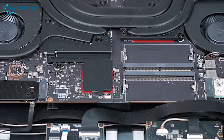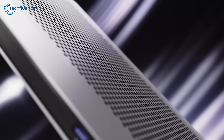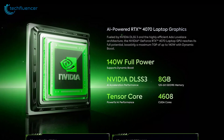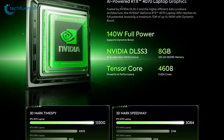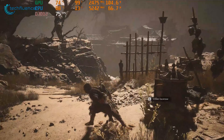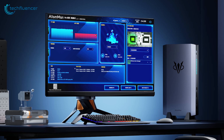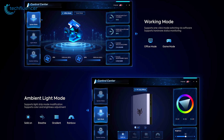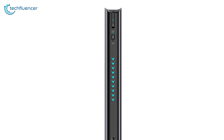Now let's talk about the interesting part — the GPU. You must be wondering how a mini PC can be so thin. It's possible when you use a laptop GPU. Inside the Atom Man PCs, you'll find NVIDIA's GeForce RTX 4070 Laptop GPU, which includes 8GB of GDDR6 memory. The GPU runs on a standard 35-watt profile but can push up to 115-watt TGP with a 25-watt dynamic boost. These features make it ideal for gaming in 1080p to 2K with medium to high settings. The Atom Man PC also includes user-friendly command center software where you can manage RGB lighting, switch between office mode and game mode, view temperature stats, and quickly enable fast cooling. You can even change modes on the fly with a simple button on the front of the device.